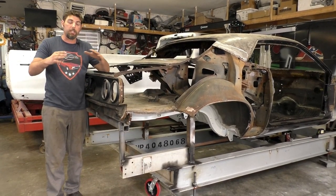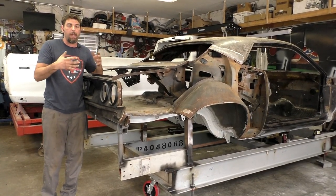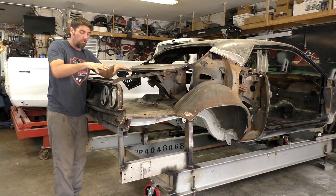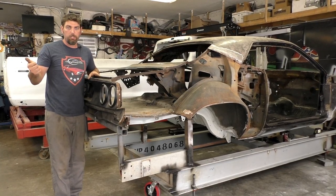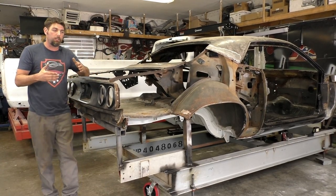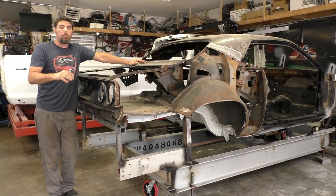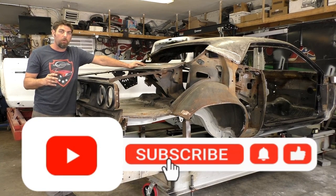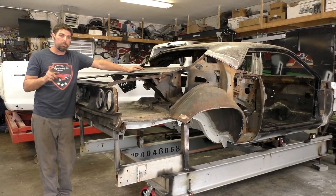A lot of people say they can't work from underneath the car with the frame jig, which is why they want to work on the rotisserie. But most of the parts we do in this shop - the cars are built with the frame rails first and we're kind of working our way on top. Get the car done, then put it on the rotisserie when you're done to clean up your welds and address a couple other welding issues underneath. But get most of your chassis work and everything together with the car on the frame jig. Thank you for liking our videos and subscribing to our channel. I'm Rick for Cartes Classic Cars and we'll see you in the next video.